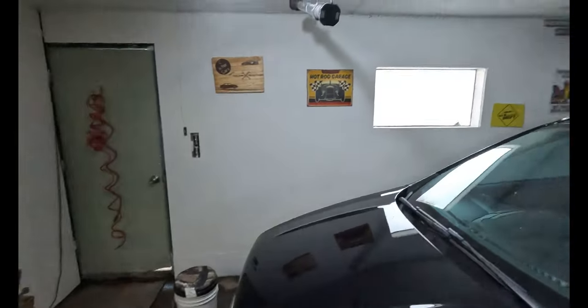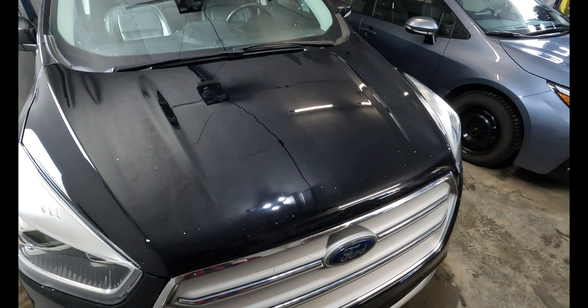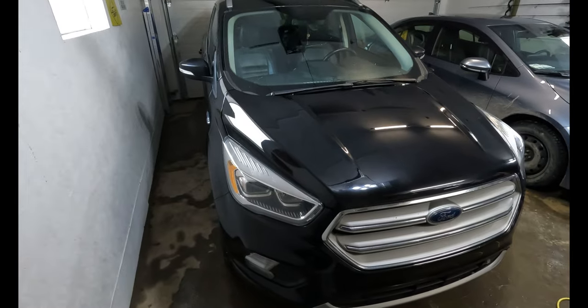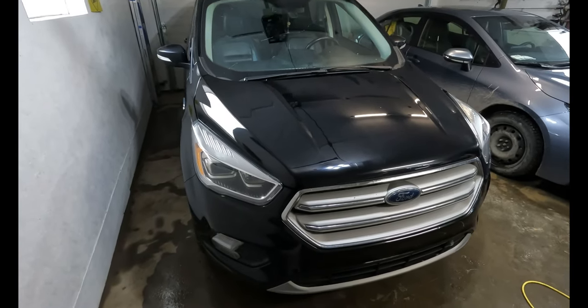It added like an extra hour and a half to the day for the sanding and then repolishing like 3 more times on it, but totally worth it. Makes me feel like I did the job right, didn't just half-ass it. I'm wishing I did 1500 grit instead of 1000. Would have saved me a couple passes on the polisher because this is finishing polish, not heavy cut stuff.